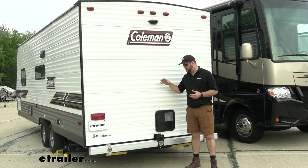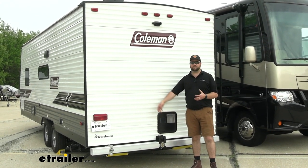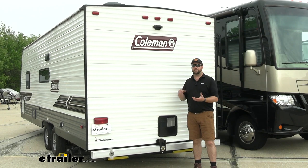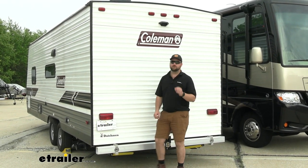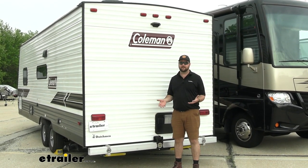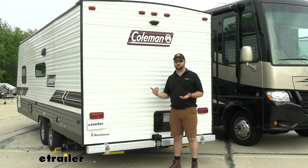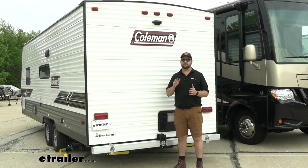We've seen it many a time: an accessory like a hitch or a bike rack is inserted into a hitch receiver and the bumper has either ripped off or twisted because the wall of the bumper — the thickness of the tube itself — is too thin and it's not rated to tow. Because they make accessories for it, people think it's okay, but most of them are not. If you do not have extra support behind your standard RV bumper, the one that comes from the factory, then your bumper is not designed for towing.